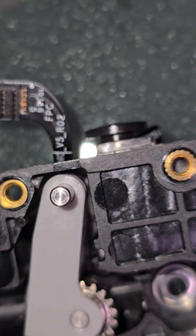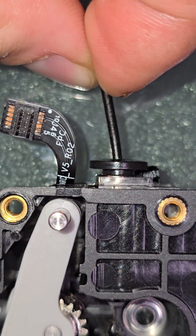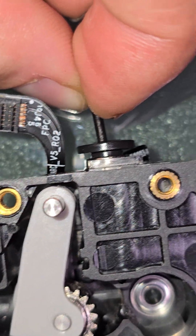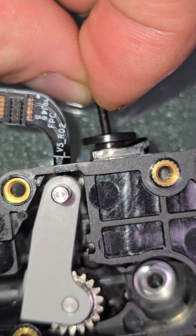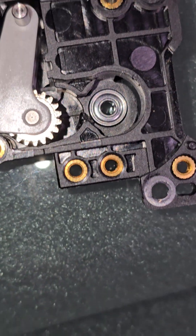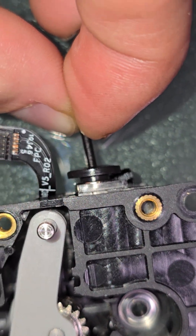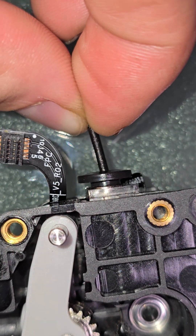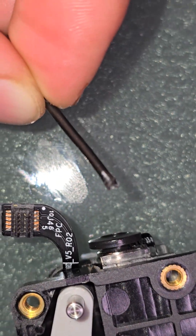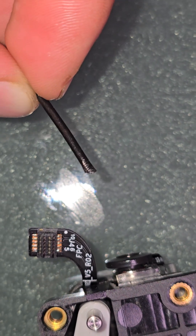It would have been at the top of this extruder. I could pull it up a little bit and down a little bit but that's it - I could not pull it in or out. I was using the load and unload functions to try to get it to come out. I had cut it using the nozzle cutter - nothing. It was bunched up in there. I eventually pulled too hard and broke it. At this point you can tell it was grinding on this, trying to push it through.